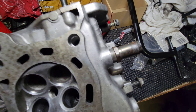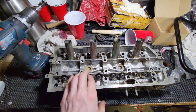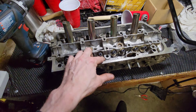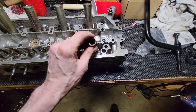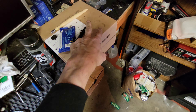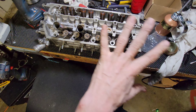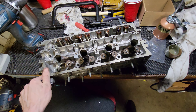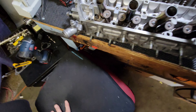Just got done doing the lapping of the exhaust and the intake — looking pretty good. Just went ahead and threw the spring retainers and the stem seals back on there — the stem retainers, spring retainers, whatever — the seats, these spinny things on the bottom. Now I'm going to attempt to put one of these guys back on, keeping in mind the orange ones are for the intake. All right, got everything back in — managed to keep everything in order. Made my little exhaust-transmission facing that way, intake this way. Kept everything perfectly. Now I'm literally down to the very last one.